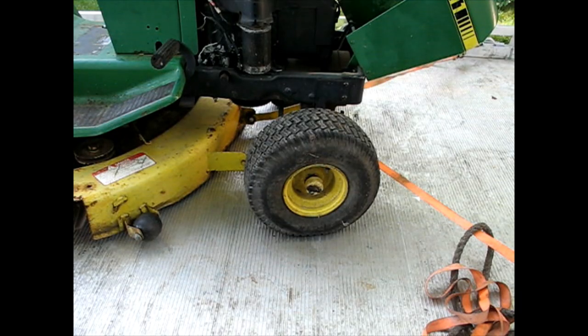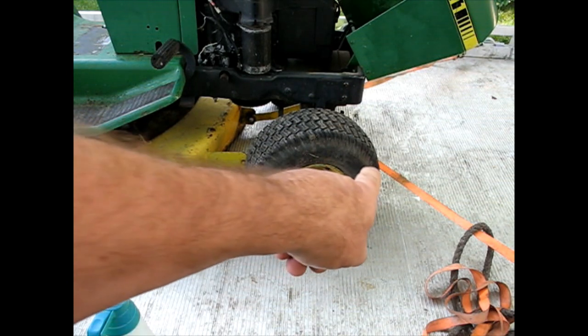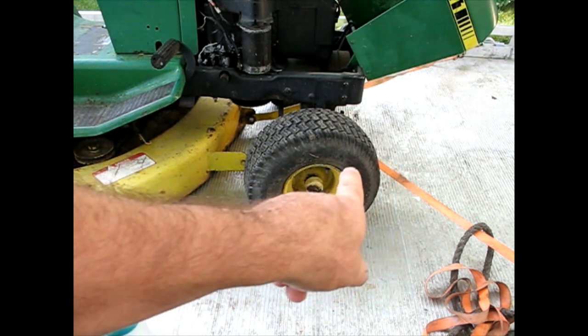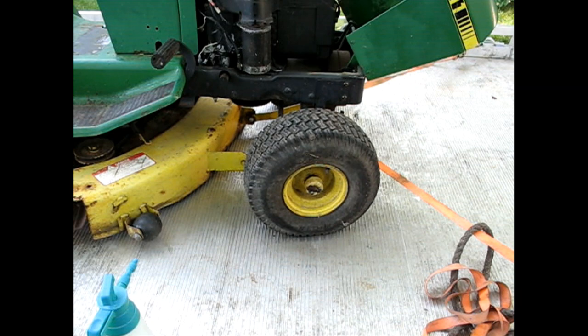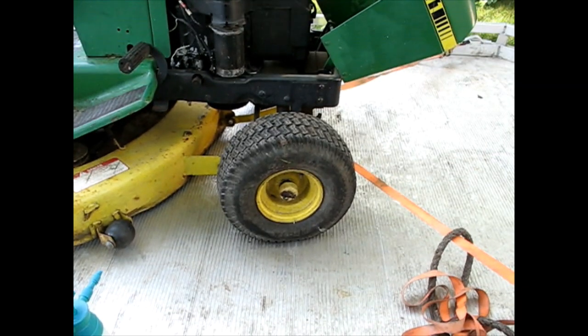Okay, so I'm gonna do the old bubble test on the tires. I don't think I hear any hissing, just out and out hissing coming out, but what I'm most suspicious of is a problem on the rim bead, or especially the valve stem, because it's customary that when you replace a tire, you always put a new valve stem on, and that valve stem does not look new, and the fact that the brand new tire is leaking leads me to even more suspicion.